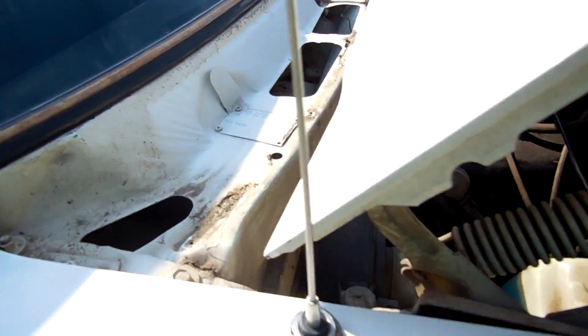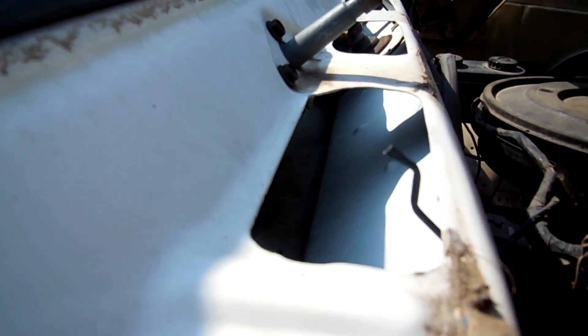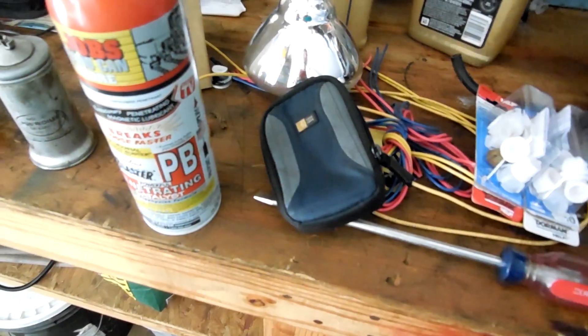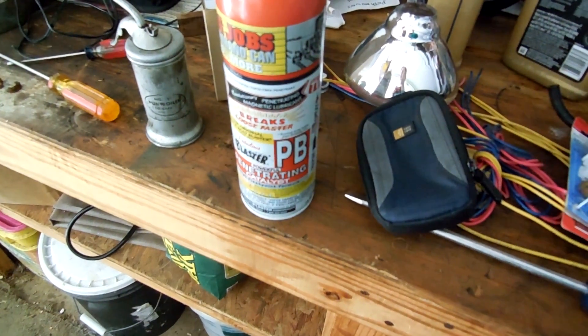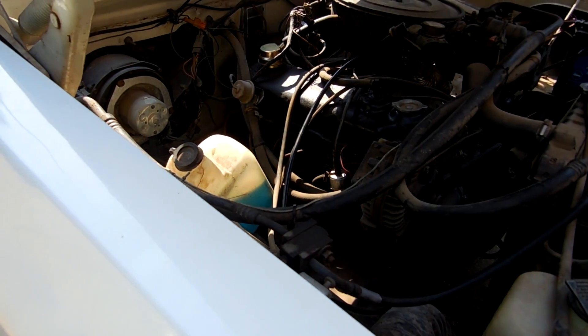I've also pulled the cowling off. There are rods up in there, and nylon bushings, and a lot of those nylon bushings were failing. That's what's left of one of them. When I was driving down the highway last Wednesday during the rainstorm, I was using my windshield wipers. I pulled up to a stoplight and they stopped working — my switch was still on and I could hear the motor humming but nothing was happening. I figured out the bushings were bad and the linkage, so I replaced those and they're all working and functional again.